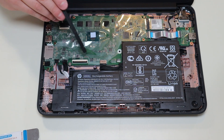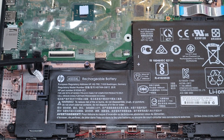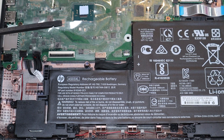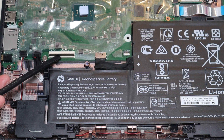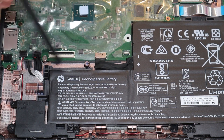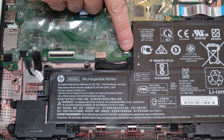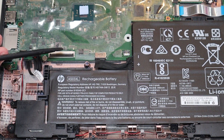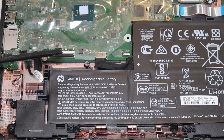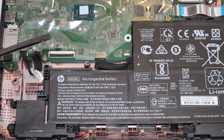This is your large connector for the keyboard ribbon cable and the smaller one for the touchpad ribbon cable — they both work the same way. This clip is black, this clip is white, and they're very fragile. You're going to take a small flat plastic pry tool and gently slide it underneath the clip and pop it up. Same thing with the white one. Then the ribbon cables can disconnect. To plug them back in, get them in nice and flush, make sure they're straight, and slide the clip down to secure them. These clips are easily breakable — if you break them, you won't be able to secure the ribbon cable properly and may need to replace them or the entire motherboard. So be very careful.